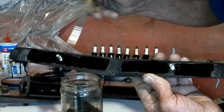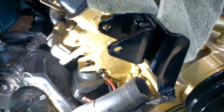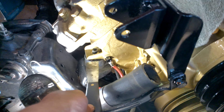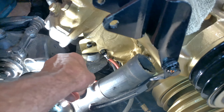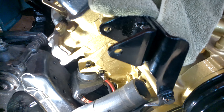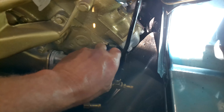I'm running across a couple of issues with this Avanti that some other Avanti restorers have come across. I tightened the rear left and right side nuts from the transmission to the cross member, and I have the front motor mounts not tightened down yet. Look at this - there's like a slack here. The engine is not resting. That's probably a good eighth or a quarter of an inch it just slides in there. But when I go down underneath and loosen the driver side nut, that will drop down and rest onto the motor mount. These motor mounts are brand new. On the right side the engine weight is resting on the motor mount like it should.